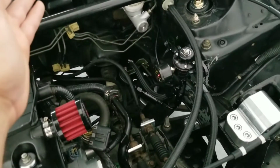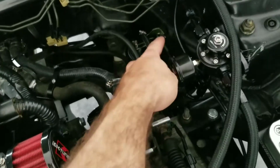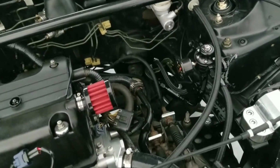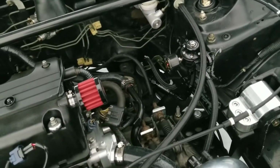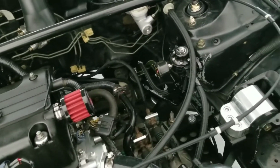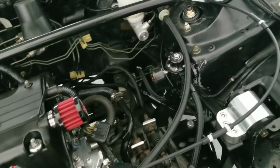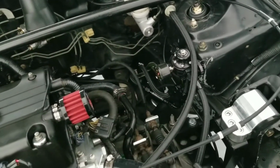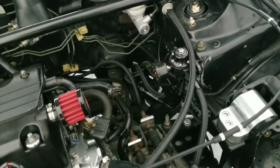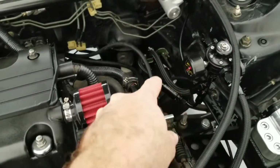When I was cutting my hard lines, I measured them how I wanted them, given that my breather, return, and feed are all precisely the same length when I cut them. I had to use a torch because it has a little rubber, kind of plastic, insulator, and it's really hard to cut if it's not heated. So I heated it up, it turned into kind of rubberized jelly, and it was easy to get a blade or a knife and just swipe it off. That way I was able to cut the line a lot better. So let's go ahead and mock this one up and do it.